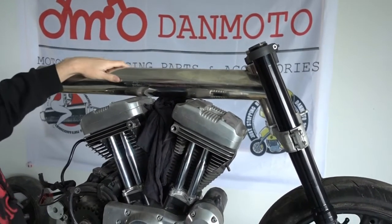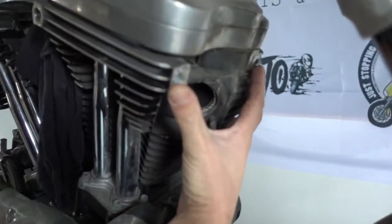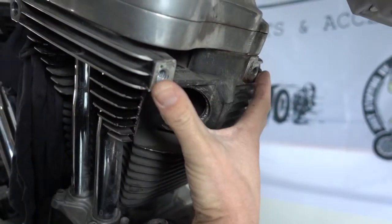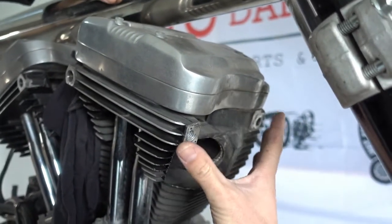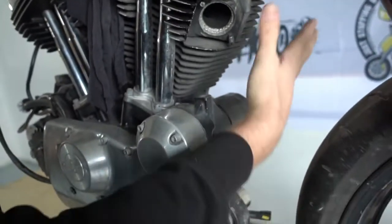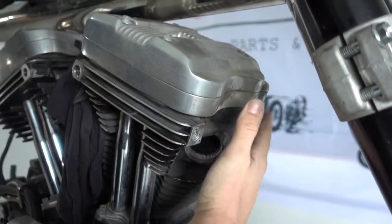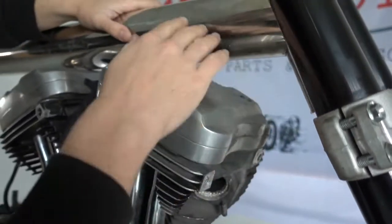The sports engine has a few advantages. Up front here, I already cast in mounting points on the engine, and later our frame will attach to these points — the frame will go down here and bolt up here. The advantage is that we don't need to go all the way under the engine; it's fine if we just bolt on at the cylinder head. We can also use these points to determine the angle and overall position of the steering head in relation to the engine.